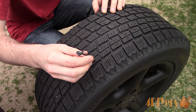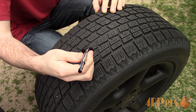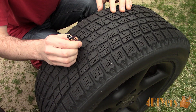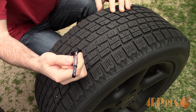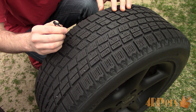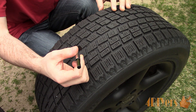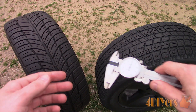As a second example, I'll be using my winter tires. The first measurement is about 7/32 of an inch or 6mm. The next measurement is 5/32 of an inch or 4mm. And finally the third measurement is the same as the middle measurement, which is 5/32 or 4mm. So these measurements would show that the vehicle has a negative camber, which could be an alignment issue, a lowered vehicle, or it could be the nature of the independent suspension depending on the design.